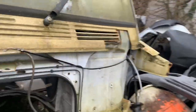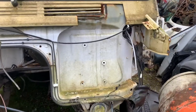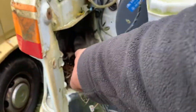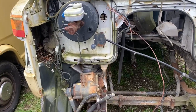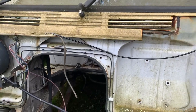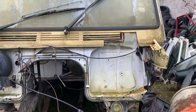I'm going to have to take this wing off, but I've planned on doing that anyway because it's actually quite good apart from the dent in the front and it is an original Mercedes one. And I will then cut this out and I'm going to have to remove the master cylinder. I can have this truck scrapped or anything taken off of it and go inside out of the way. But I'm going to cut the whole top of that bulkhead clean off. The other choice was — if this one hadn't had that corner off of it — you can actually de-seam them all the way through here, up over on the top, round down, and pick them out and take the whole bulkhead out. But obviously, cost-wise, it's getting expensive now for this fella because this is a lot of work.